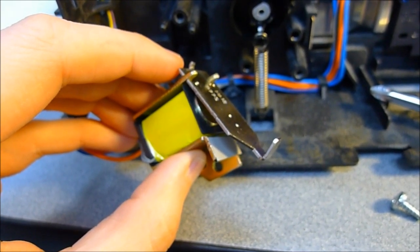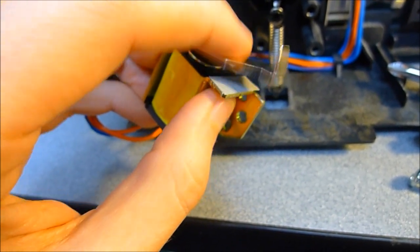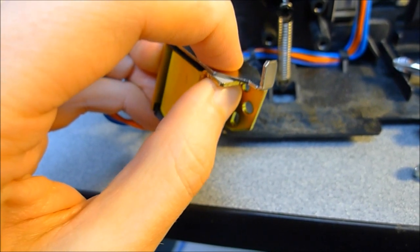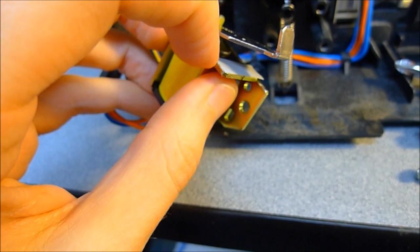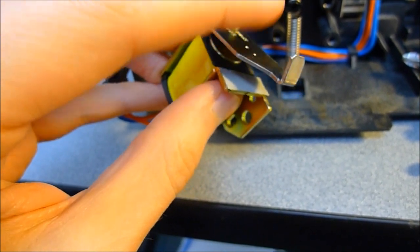Once you've taken care of the other two solenoids for tray one and tray two, right before you put it back on, go ahead and give it a try. You should be able to press on the armature really hard and still not have it stick at all. That should mean that the adhesive, thanks to the little electrical tape I put on there, is not going to pose a problem, and we're not going to have any issues with residual magnetism either.